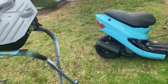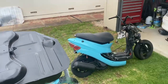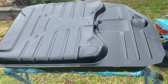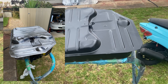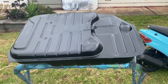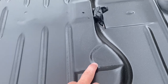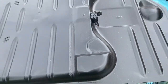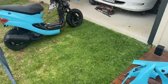One of the other things I got done in the meantime was this petrol tank here. It had a fair bit of rust — just surface rust sitting on top of it — and was pretty dirty. That's out of the VSU that we got, and we had to change the fuel pump on this to get it going. While it was out, I took the top back to bare metal, got all the rust off, then put a rust converter primer on it out of an aerosol, and then a satin black on top. Looks much better now and hopefully will stop the rust going any further.